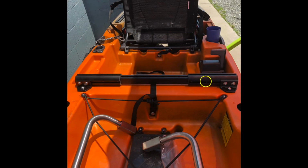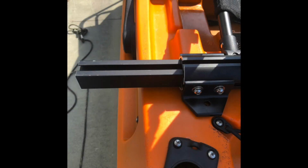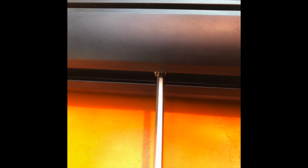Now let's cut the spacer bar to length. Slide one end of the spacer bar into a knuckle with the set screws facing the rear and the groove in the bar facing up, about 1/2 inch past the outermost set screw on either side, and tighten the screw. Slide the opposite end into the second knuckle and position the assembly where it will be when the installation is complete.